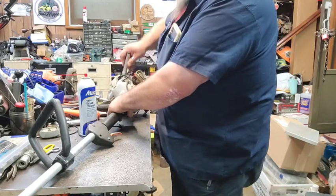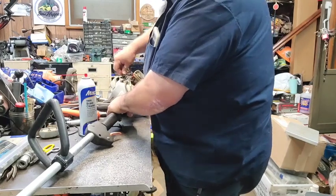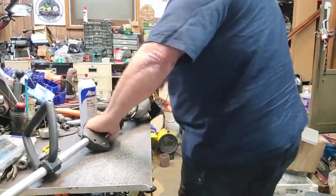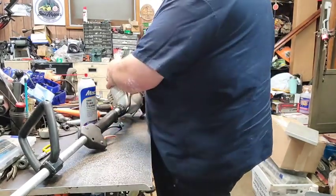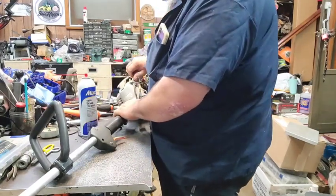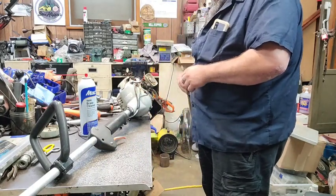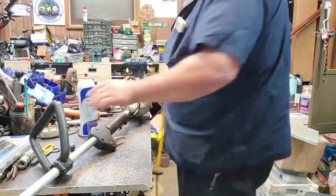Sometimes this does take a few shots. We're not, like I say, we ain't trying to get anything that tight. We might have actually had some fire that time. I got a feeling there's more water on the plug, but I think the bottom end's full of water. I believe it is. Yep. Always a pain whenever this happens.